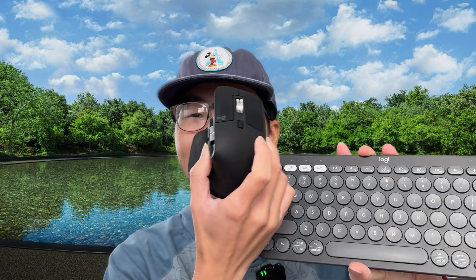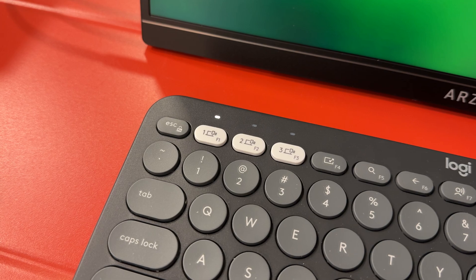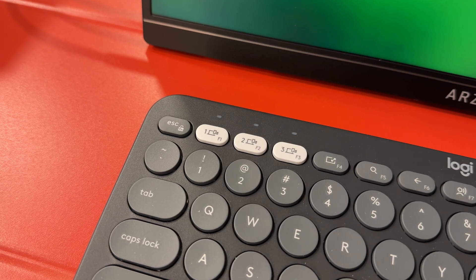If you have a wired keyboard and mouse, that's easier — you just hook them up and start using. But I was using my Logitech Bluetooth keyboard and mouse, so I couldn't just plug them in. I tried putting both my keyboard and mouse into paired mode. The LED light on them started flashing, and fortunately, after a little while, my Mac Mini detected both and they connected. I was able to go to the next screen.